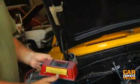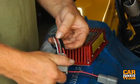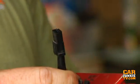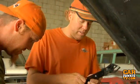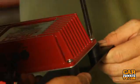Installation of this is really easy. Most guys are going to mount it to the firewall, but we decided to put it in under the dash. You've got black and red going to your battery power, a red going to your hot ignition source, a wire going to your tach, and then black and orange going to the coil. It's only going to take you a few minutes if you've got a billet distributor like us. Chad made these little brackets so we can mount the MSD up under the dash without having to drill any new holes, and we always use the little rubber vibration mount feet that come with the MSD so it doesn't shake the unit when it's in the car.